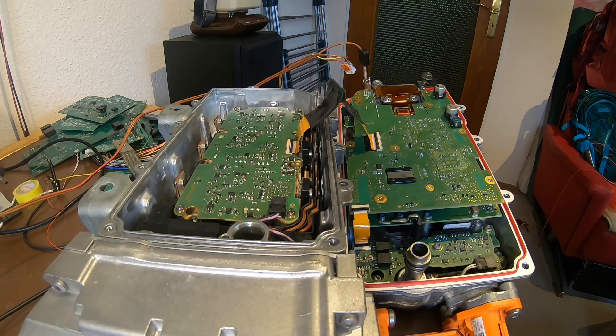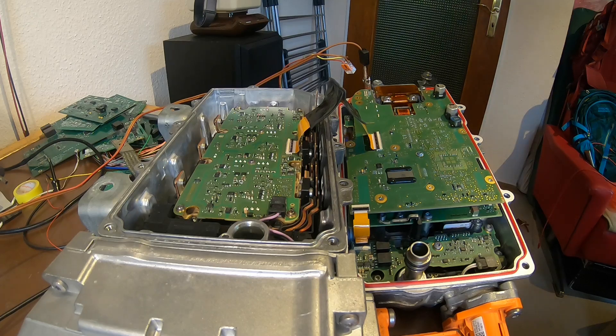I have actually run the Zoe motor with some other inverter by feeding it a constant current into the rotor. It turns out when you start the field current, this actually feeds back into the rotor as well — so the lab power supply was like supplying current, no current, current, no current. It all looked quite wacky; it looked a bit smoother when I supplied it with a battery instead. So I'm not quite sure about the theory of operation of such an exciter winding.